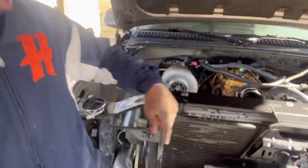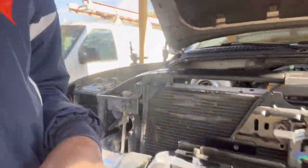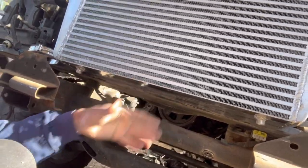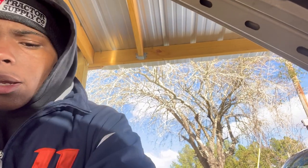Today's goal is to get this cold side right here done. As you can see I kind of have it marked up. I also want to mount this bracket here. I'm going to cut up a piece, paint it up, and make sure this thing is nice and secure — it ain't going nowhere. We just need to get that bottom side firm. I'm going to go to the auto parts store and get an oil pan gasket. We got our no-weld 10AN bung and I'm ready to put that on the oil pan. Once we get the gasket drilled in and buttoned up, I can put this pan back on and run the drain line for the turbo.